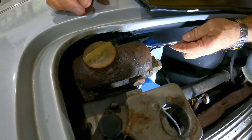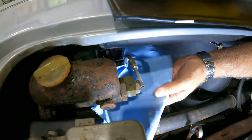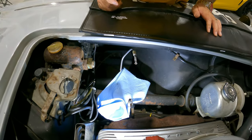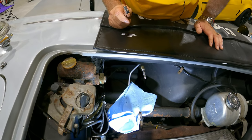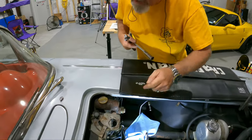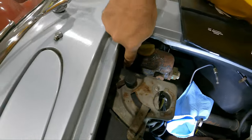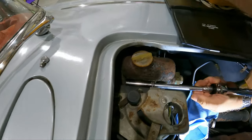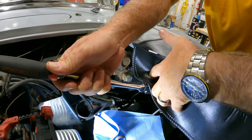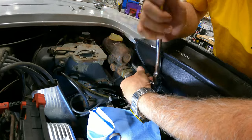That's loose. I'm going to pull that line back out of the way. As I've said before, you want to make sure with brake fluid that you clean it up immediately if you get it on paint because it's not kind to it. That was a 7/16. Now we're going to go ahead and try to take these three bolts off. I did go ahead and hit them with some penetrating fluid. They are a 9/16. Don't lose these nuts because when we go to put the new one on, we are going to reuse those. Be careful around the edge of this so you don't whack the fender. I'm going to put the fender cover underneath it so that if I do, I don't chip paint.